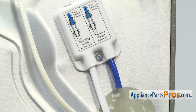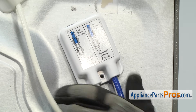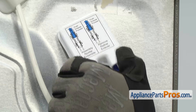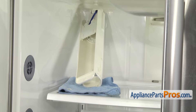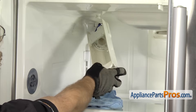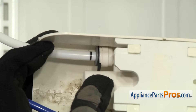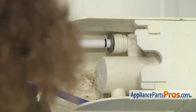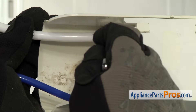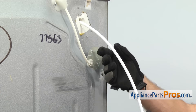Once you have it out of the way, we're going to use our Phillips screwdriver to take the screw out so we can take the cover off. Once you have the screw out, you can just release this tab right here and lift it up, then set it aside. Now that we have everything released from the back, we can go around front and disconnect the line from the filter head. We're going to grab the assembly and pull it all the way out to the front of the fridge. Once you have it pulled to the front, you can see the water line is attached right here and it has one of those locking tabs. So we're just going to reach in and pull that out, then take a 3/8 inch wrench to press the locking collar in so we can pull the water line out. Once you have the water line disconnected, we can pull the assembly out of the refrigerator. Now we can go around back and pull the water line out of the back of the refrigerator.